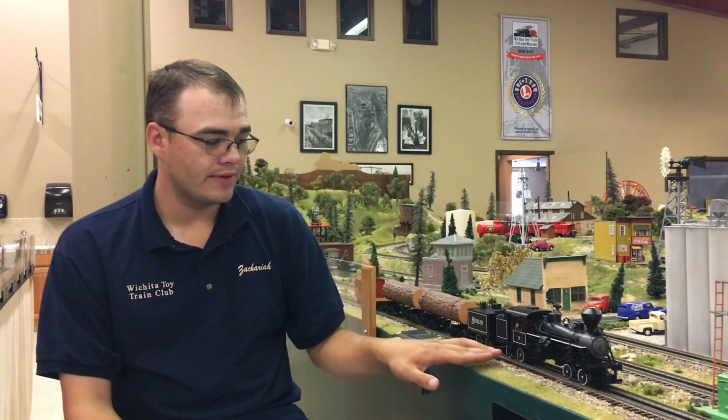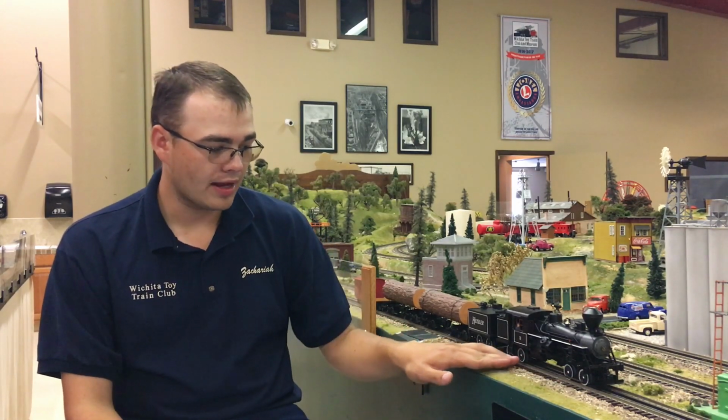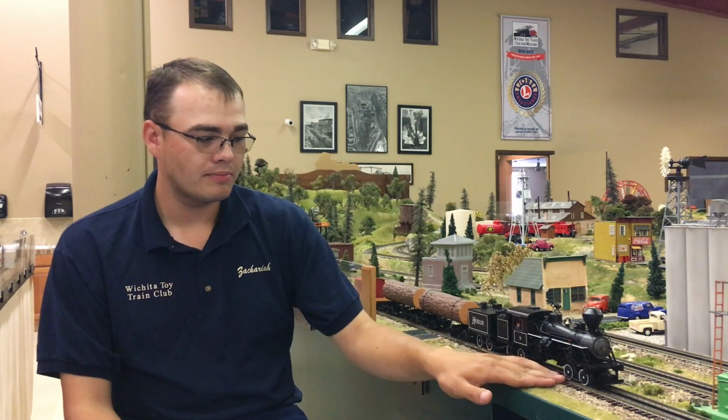There at the center, those two cylinders in a kind of V-twin configuration powered a horizontal drive shaft that powered the outward axles of each truck, and then the inward axles were powered by the external side rod connecting rods.